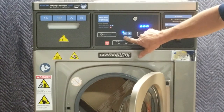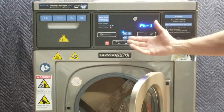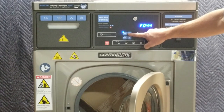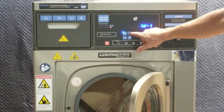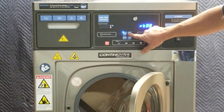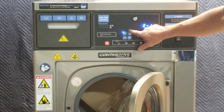To create program two, I re-enter the code — one, two, three, four, one, two, three, four — select programming, and now I'll work on program two. Phase one off, phase two off, phase three off, phase four I'll turn on. Level three, temperature up to 95 degrees. Dose one selected, 25 seconds flush time, no second dosing, high agitation. Rotation time — making this a medium soil program, so instead of 12 minutes I'll have nine minutes. Rinse hold no, simple drain at wash speed.